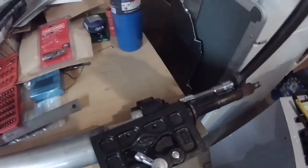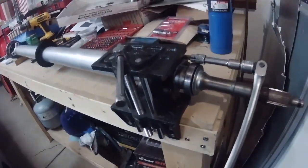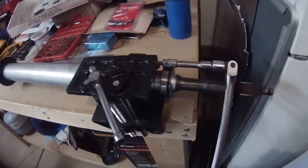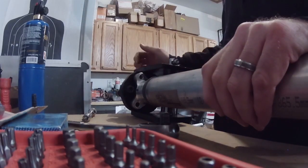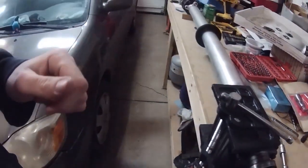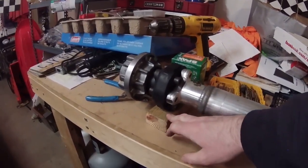That's free. I will tell you, that is significantly easier. If you use this propane torch to heat up the Loctite, I'm pretty sure you could use a super cheap socket like this one from Menards that was $1.97 or Harbor Freight or whatever. Another tip when you do this - when you put it in the vise, put your rubber coupler in the vise. That way you don't have to worry about damaging the aluminum drive shaft. Also have the end of it here supported so that the snubber isn't taking the brunt of the weight.